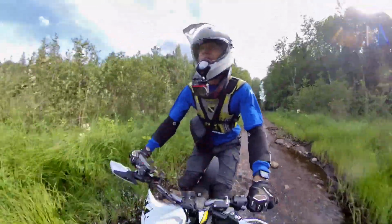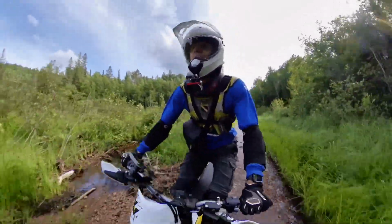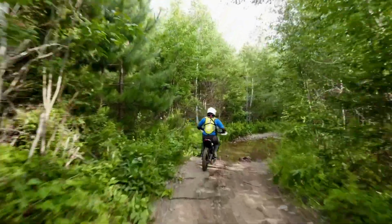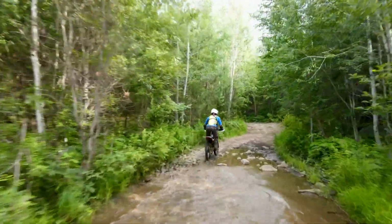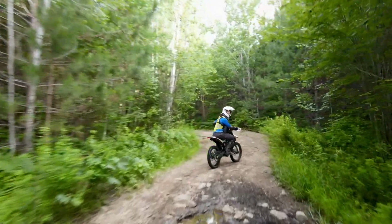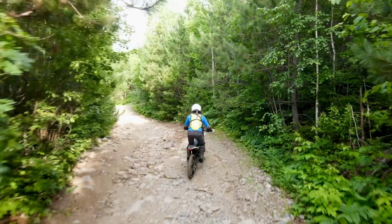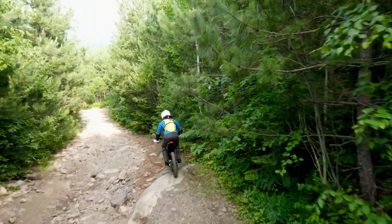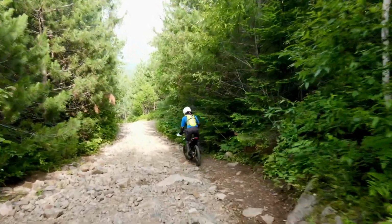In terms of suspension, the bike delivers 240mm or 9.4 inches of travel at both ends, and the suspension is fully adjustable. The unit I tested was set to the middle of the road setting and I found it worked well, but when I get my own, I'll have to play around with the settings. Ground clearance, which with the stock wheels is about 12.5 inches, is enough to clear some pretty big rocks and logs, but still falls behind other hard enduro bikes.